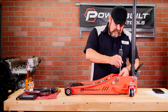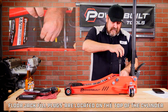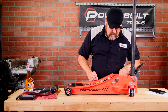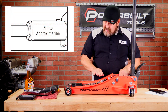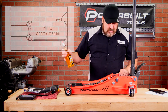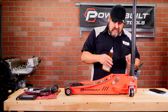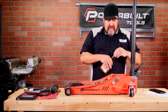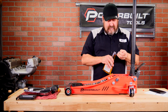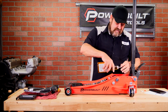To check the fill level, we'll take a number three Phillips screwdriver, open it up, and check the fill level. Our fill level should be even with the piston that pushes forward to lift and lower the jack. Jack oils are available with and without stop leak — this particular model we got with the stop leak. So we can open this up and begin to fill the jack.